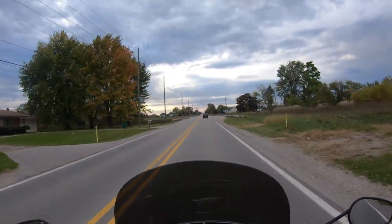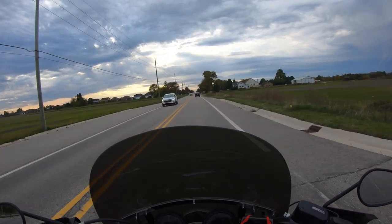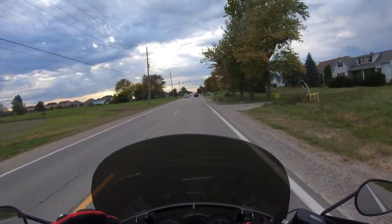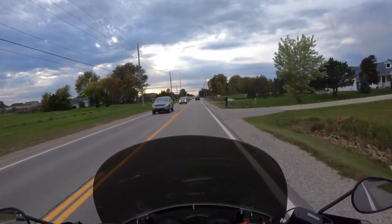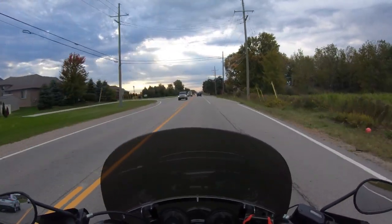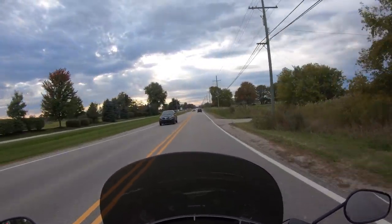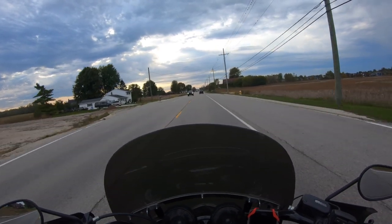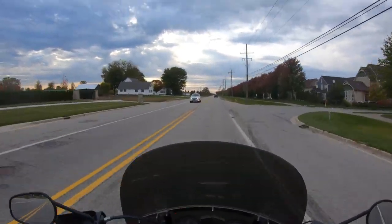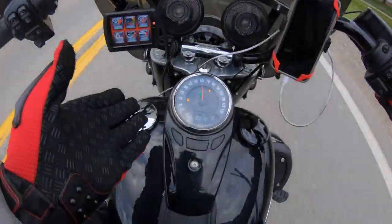People are saying, oh, I put in a high flow, high volume oil pump, and it's still sumping. And that's because if you aren't getting enough oil into your return, then it's not going to pump anything out but air. And when you pump air through your pump, A, you can mess a lot of stuff up, and two, you're going to create pressure in there so that even if oil could pump through, the pockets of pressure would keep it from doing it. Oil is supposed to cycle through the whole motor, and when you don't have that, then you start creating these issues.